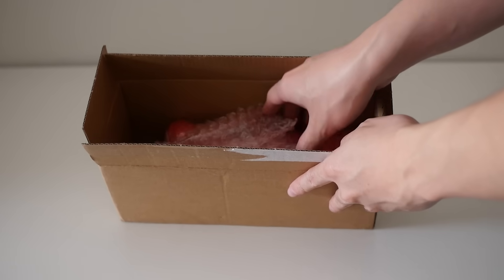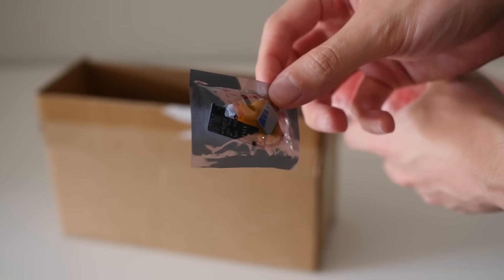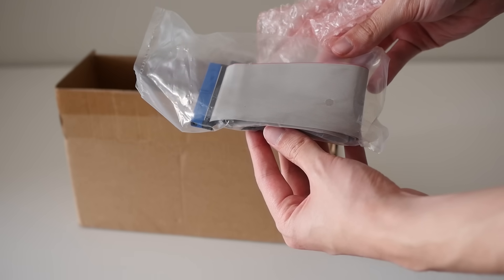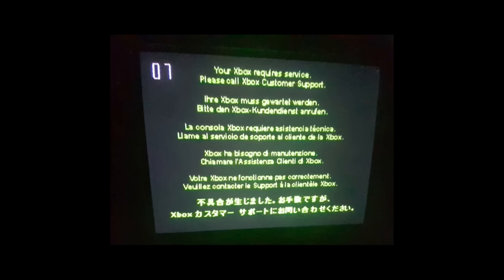Here's the box I was sent. Andro was nice enough to send me some extra stuff with it too, like a replacement battery for the clock capacitor — an actual battery, not just a power store aerogel — as well as an 80-wire IDE cable. You'll want these if you replace your hard drive with a newer one, because the extra wires reduce crosstalk allowing faster speeds. In fact, on the original Xbox, trying to use a faster drive with only a 40-wire cable can cause it to fail detecting the drive at all.